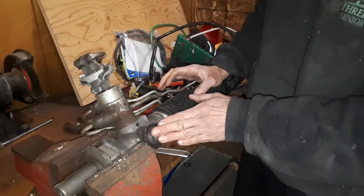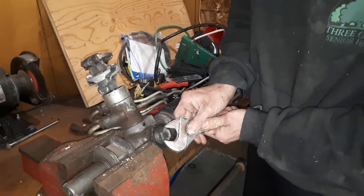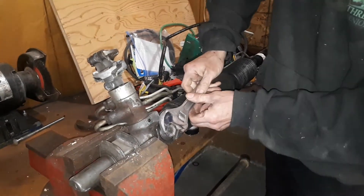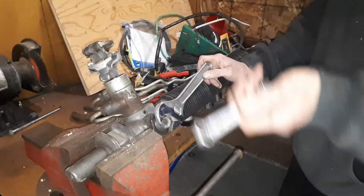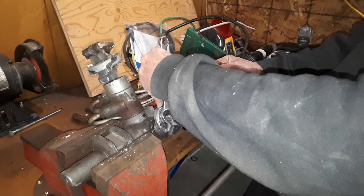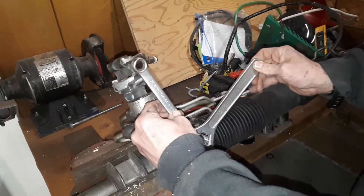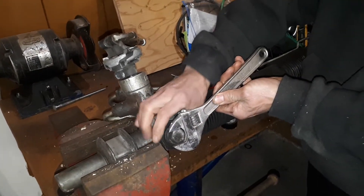The jam nut is now loose, and now I can adjust this nut. Take an adjustable wrench and lightly bottom the adjustment plug nut — just go until it's lightly bottomed, don't torque it. Then you're going to turn back 60 to 70 degrees. What I like to do is use my wrench handle as a reference: there's 90 degrees, so take 20 to 30 degrees off that — there's 45 — somewhere in between there is where I'm going to turn it to. You can even use a clock reference: I'm going to turn that back to about 11:30.